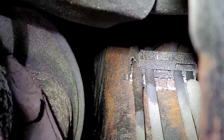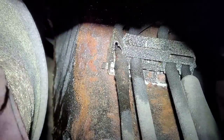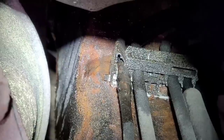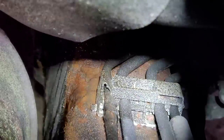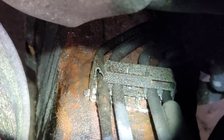I'm going to have Moe step on the brakes so we can see something. Go ahead Moe, push it down. Just keep pumping it. Oh, there it goes — you see it? Yeah, it's actually rotted through. I'm surprised it's not siphoning the master cylinder out. So that line is rotted — it looks like I'm going to be replacing a line. I would never have thought that. I've still got to pull the wheels off and check the rear brakes, then we'll go from there.